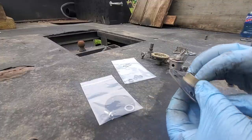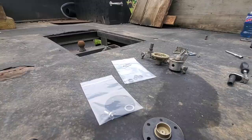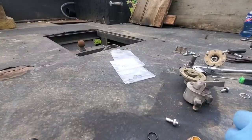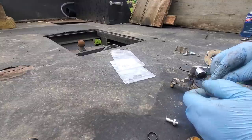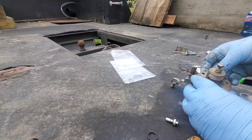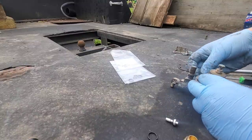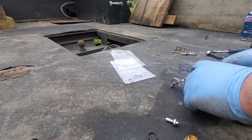There's the rest of the diaphragm. Let's get this stuff off the diaphragm so we get the diaphragm swapped. I think that's going to be it for the parts on here. So we got the diaphragm out of these — they were just stuck to it. The bottom half of it's in. We get this lined up with the holes, top half on. We'll kind of just hold the whole thing together until we get a couple bolts in it. There is a bracket that goes on this side of it — I'm going to put these couple bolts in over here first.